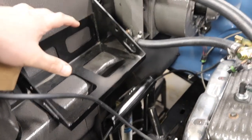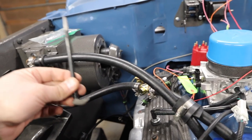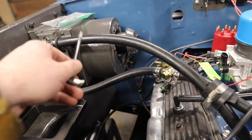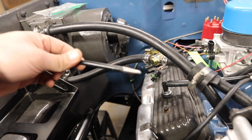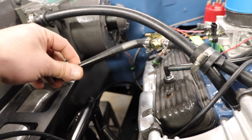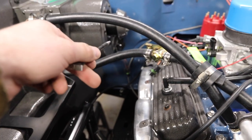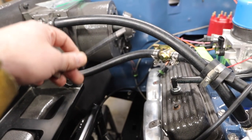I got my battery box and the heater recovered. Here's a tip: I have these conical tools in like three different sizes — I think they sell them at Harbor Freight. Down in here there's a hole where the control comes in for a flap on the heater vent. It didn't line up, so what I did was I shoved this conical piece in there — it's like something we use in industrial applications when you're trying to get steel members to line up. You stick something conical in there, wrench it, force it into alignment, and then bolt it down. That's how I got that to fit. I had Mrs. Matt's Garage pulling from that side, then I bolted the heater down. That applies to a lot of different things.